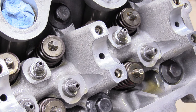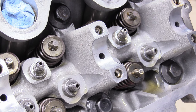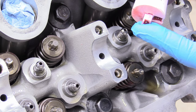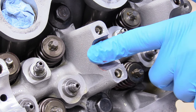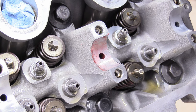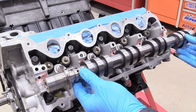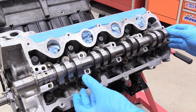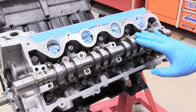Just like a bearing — this doesn't have camshaft bearings, it just rides on this surface here. You can kind of see there's a little bit of pitting from its previous use, and that's okay — this has already been checked by the machine shop, everything's fine, it's been line honed. I'm going to take a little bit of Permatex Ultra Slick on the end of my finger and just help it out, give it some starting lubrication and give the cam its best chance of not eating this surface. Just don't get it on the cam tower mating surface right here and you'll be good to go. Do that for all of our cam towers, then gently put in our freshly cleaned camshaft. Don't worry about it falling off — it's pretty stuck in there — but if you're really worried you can always tilt the engine until it's completely parallel with the ground.